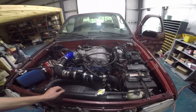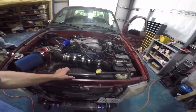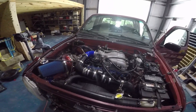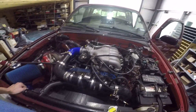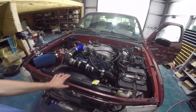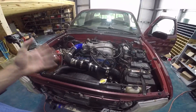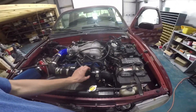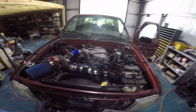My long-term goal for this thing is 300 to 350 horsepower. Guys have done way more and way less and had success either way, so I'm going to stick somewhere in the middle. I'd also like to make around 380 to 400 ft-lb of torque — these things make a lot of torque, 220 from the factory along with 190 horsepower, so going to 300 HP and 400 ft-lb is a big improvement. On 4 PSI alone I can already feel it; this thing hits boost and the whole front end just kind of bucks up a little bit and takes off.